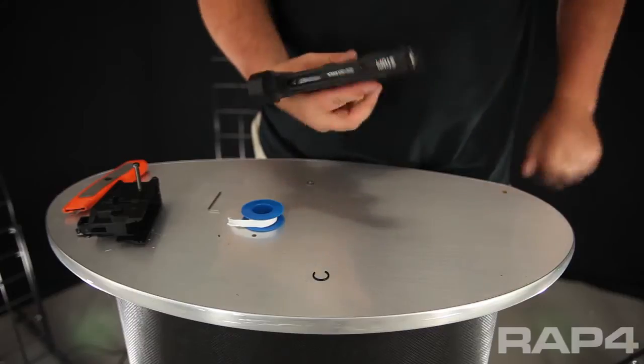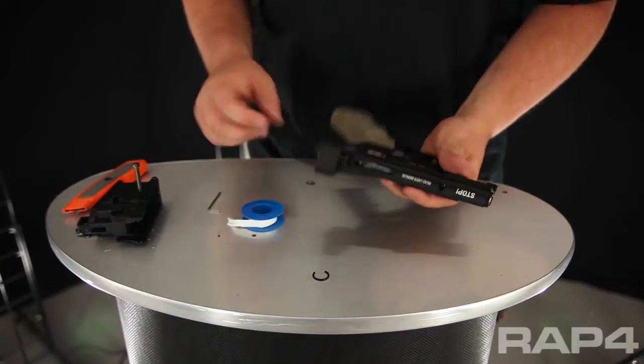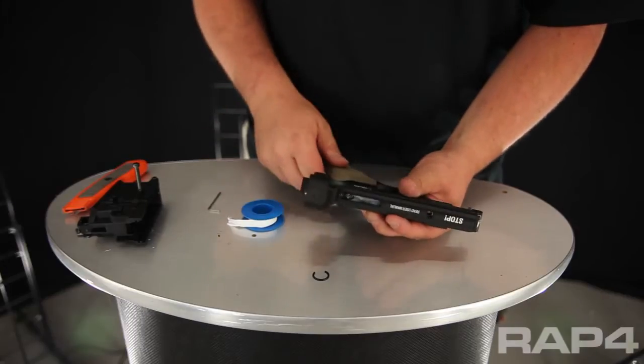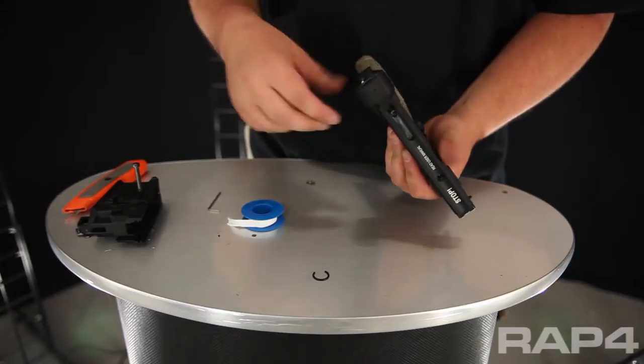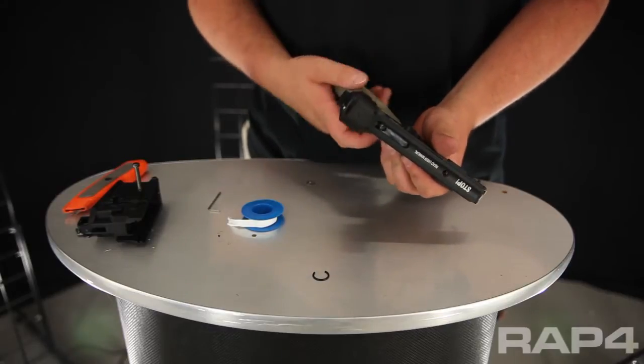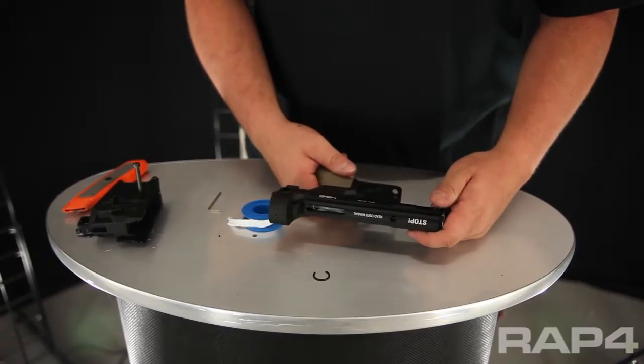We're going to just go over a couple of air leak tech issues and how to solve them and get them taken care of quick. When you're trying to diagnose the air leaks, one thing you can do is take a little bit of water, spray bottle, or just a couple drops off your finger, and where you think you're hearing the leak coming from, go ahead and dribble some water on it. What that'll do is help you pinpoint exactly where it's coming from and give you the ability to troubleshoot and fix it that much faster.